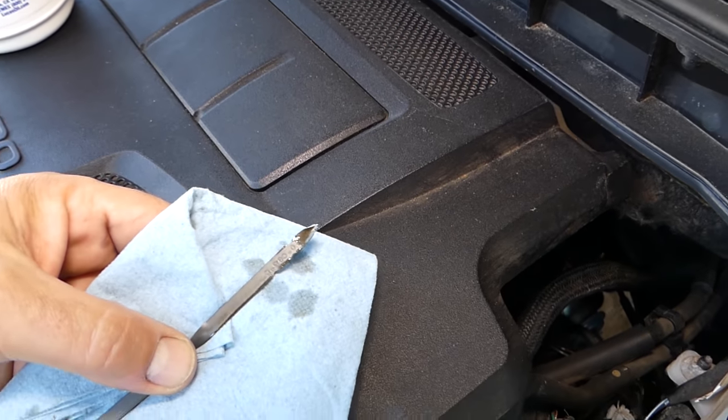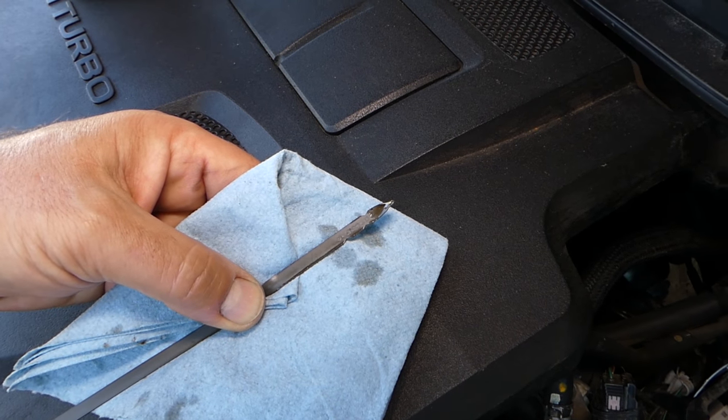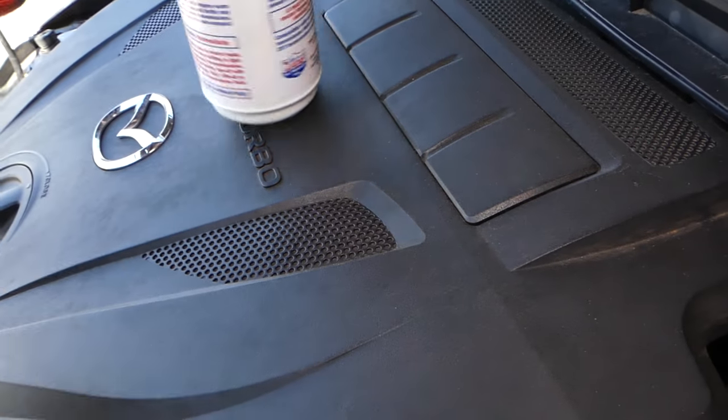Surprise — we are not even reaching the 20 degrees Celsius mark on the dipstick. As you can see, we are definitely low on transmission fluid, and that is most likely what is causing the slippage in our case.